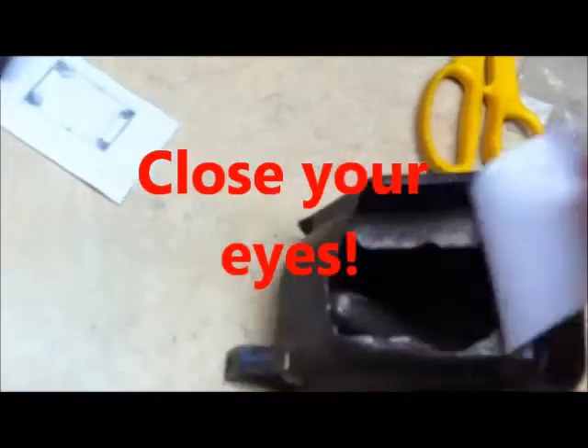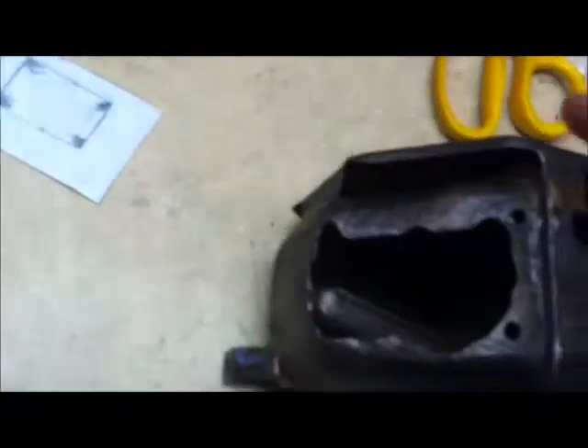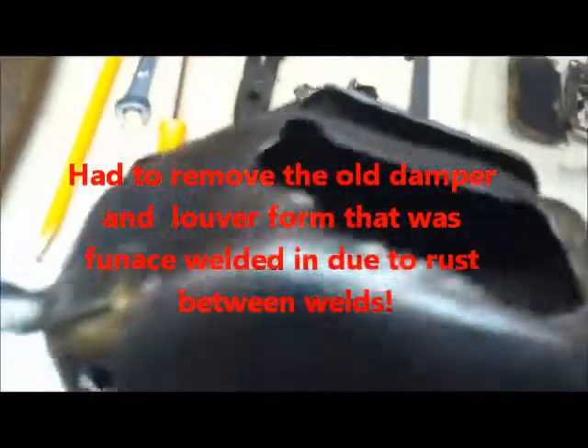The early 090, or Contra G and Contra GS, the early ones had a solid cast aluminum muffler and those look really cool — that's another video. Let's get back to this. Here's a template I'm going to make, a little cut out there. It'll fit in there really well once it's all together. This is the plate I've got to replace here. I'll heat it up, it'll go on there real nice. Let's see the actual damage. That's the actual template I'm going to use.